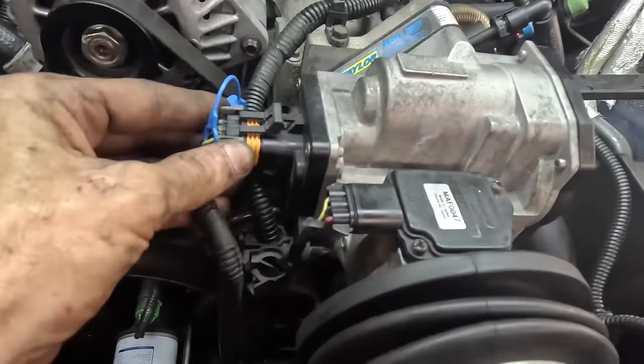No debris floating around in it. Yeah, I need to give this thing a quick drain. Pull out about a half a quart. Zip tie this wire up, and then we'll let her down all the way, back it out, and get this cooling system cleaner inside of the radiator. All right, let's just find out once and for all how effective some of these products can be. So we're dumping in